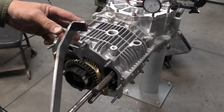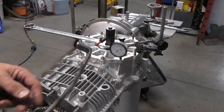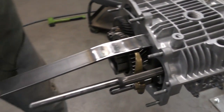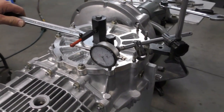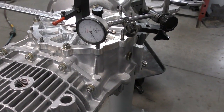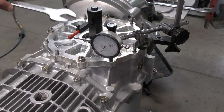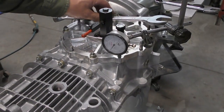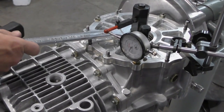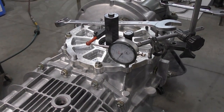The tool I'm using here is in the 911 Carrera shop manual — there are dimensions and instructions on how to make it. What it does is it locks up the pinion shaft so I can check my backlash. You take this tool, it slides in on fifth gear, make sure fifth gear is selected, just a little bit of upward pressure to stop it moving, and then I can check my backlash. My optimum backlash on this one is 0.16 of a millimeter as inscribed on the differential. For a diff that was recently set up, this thing was a mess — bearings had been loctited on, I had to cut one bearing off, the preload was incorrect, and the backlash was really incorrect. I've got it all back where it needs to be, preload where we need it, and now we're ready to reassemble the entire transmission.